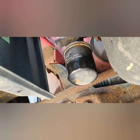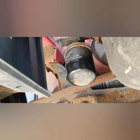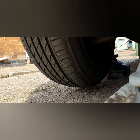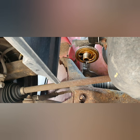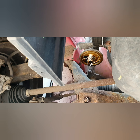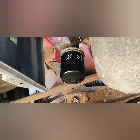There's the oil filter and I can't turn it by hand, so I'm going to have to either use a big pair of grips on it or stick a screwdriver through the barrel and try and turn it that way. I'll go with the big pair of grips — and it turns. Right, I've got the filter off. I'll just let it drain off a bit, then put the new one on. Always put a bit of oil on the washer before you put it back — just helps it seal. Right, that's the new filter on.